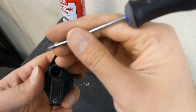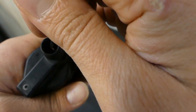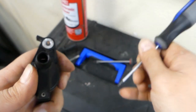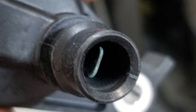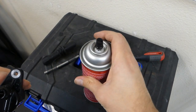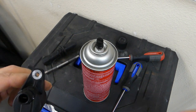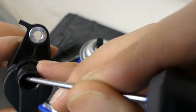So what I would be doing is — you see the connector — and you just start to scrape. You're going to see that stuff start to come off. You just work your way across the connector, trying to scrape as much off as you can. Then after I've scraped it a bunch, you'll see the color change — because it's going to go from that corrosion-y blue-white to a nice copper look. I just spray that cleaner in there and let it dry off. I've even taken a Q-tip and dabbed some of the debris out that won't come out. You can also use compressed air to blast some of that out. I just continue working it, trying to scrape off as much as I can until it's done.